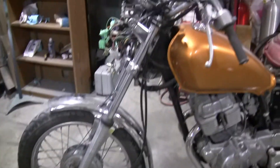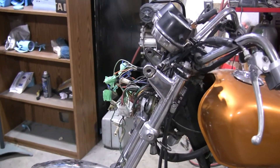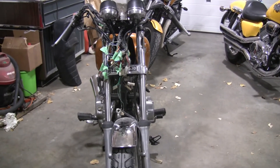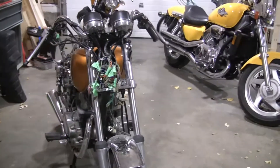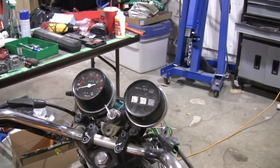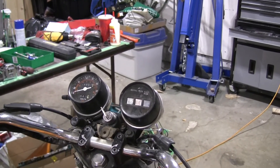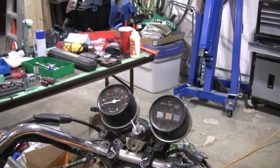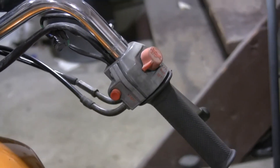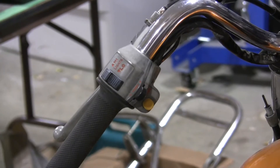We'll probably do something with the front fender — make it a little smaller, cut it down a bit. That bracket is busted as well. We're going to rebuild the whole front end: new fork seals, new fork oil, and probably do the head bearings in the triple tree. These gauges have to go — I don't like having this whole gauge circle just for three little lights. We'll mount some smaller LED lights instead, probably move the choke and potentially the key. The controls are looking pretty tired so we'll powder coat them and repaint the switches on both sides.